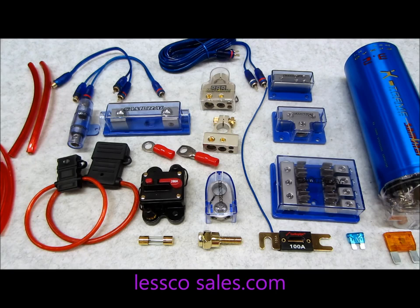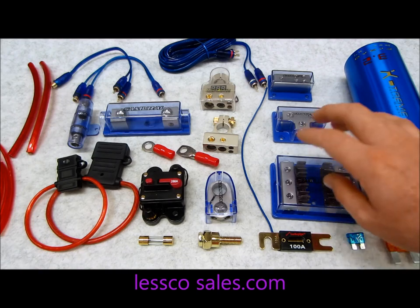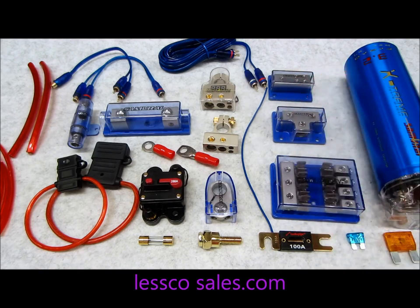You'll also need to make fewer connections at the battery. Since there's only one wire, you only have to connect one ring terminal at the battery post and only one fuse holder under the dash to feed the whole audio system. When using one large wire for multiple amps, you'll need a way to split the power wire into smaller wires for each component, which you can see I have some distribution blocks laid out over here.